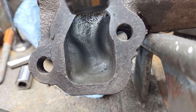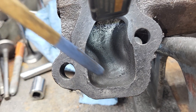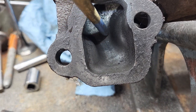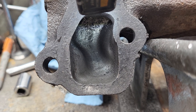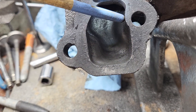On the other side, you can still see an outline of that casting mark all the way down the bottom. This is much deeper than it was stock. If you make this deeper, you can give it more of a radius turning around — that's going to help. Do not make this too thin; you need some metal here to seal the gasket.